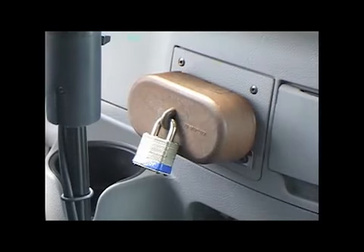The 7-way plug is known as the pigtail. It is vital that the pigtail is properly attached to the trailer prior to leaving the distribution center. This will ensure that your liftgate has power to operate once you have reached your destination. Turn the key to the on position or have the truck running and ensure that your truck and trailer is secured.